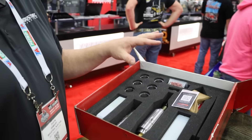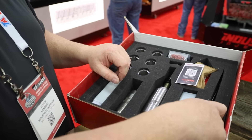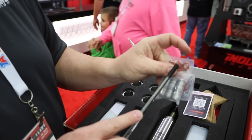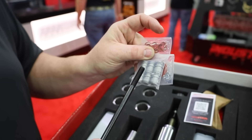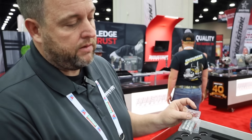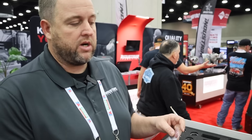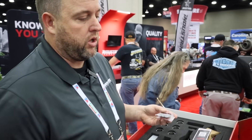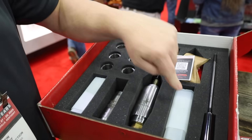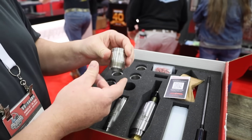There's a nice desiccant pack in there to keep rust down on the tools — a lot of it's stainless, some is mild steel. In this package you've got your plugs and o-rings — the o-rings go on the plugs. These allow you to do this job on the truck: take the injector out, put this plug down in the hole, and that keeps metal shavings out of the chamber and cylinder during machine work. We also have a guide ring, two taps, the extractor or puller, and the tool that installs the six cups.